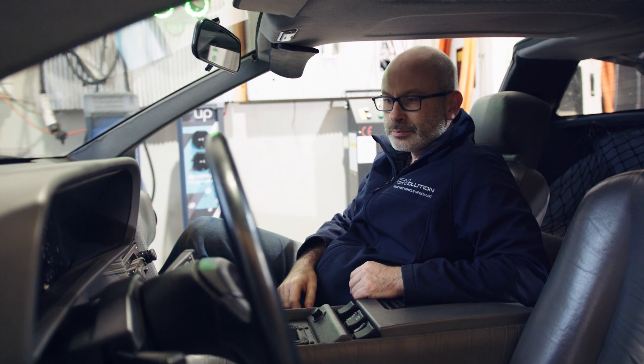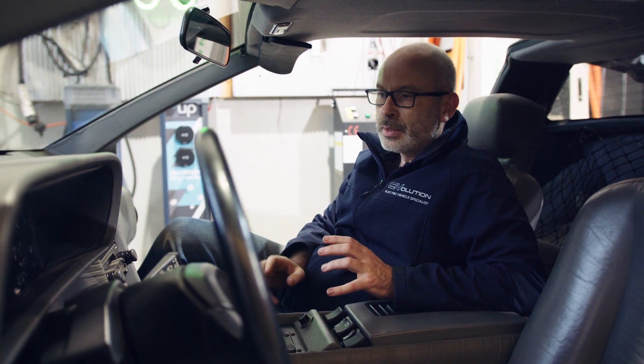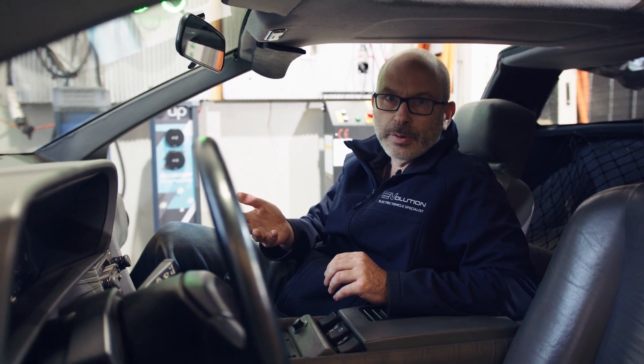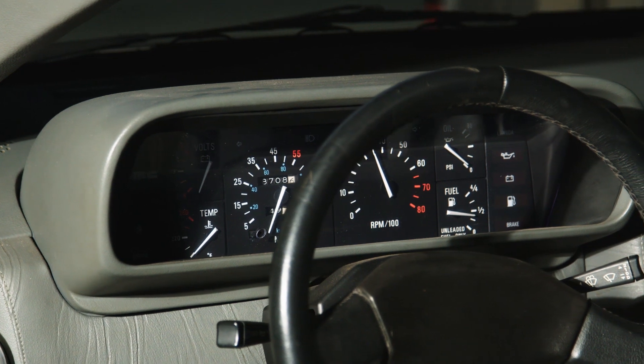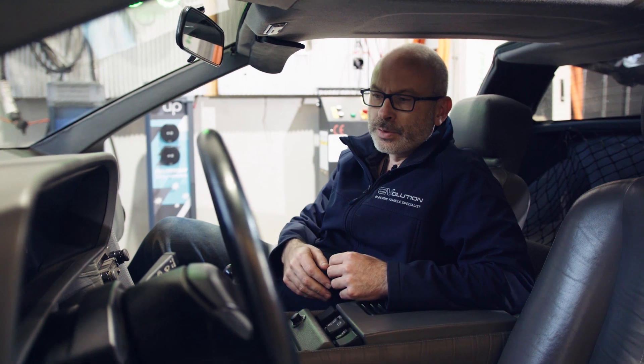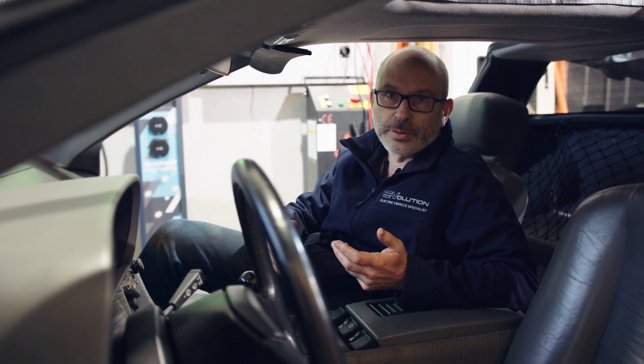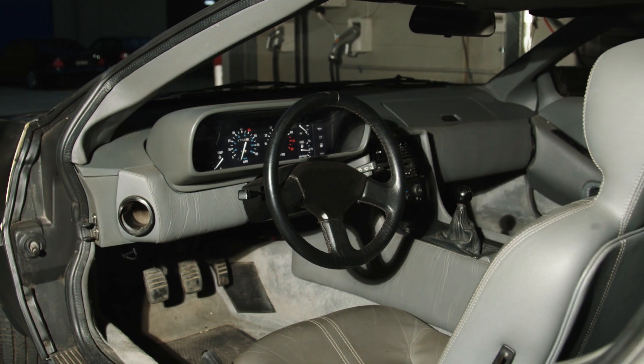So in here, it was probably quite modern for the 80s, but now it's getting pretty dated. We really don't want to change any aesthetics, so there won't be any Doc Brown style dials or flux capacitors — we'll keep it as standard as possible. All the dials will be repurposed accordingly: the fuel gauge will become the electron gauge, and the RPM gauge will show motor RPM. We're also going to have an Android head unit which will show range to zero, along with charge timer and remote heating control. The seats will remain and we'll probably be recovering them in leather and fitting them with heated seats, which consume a lot less power than a standard HVAC system.